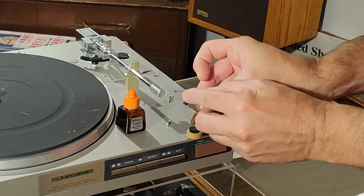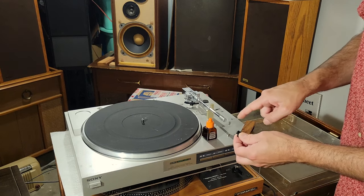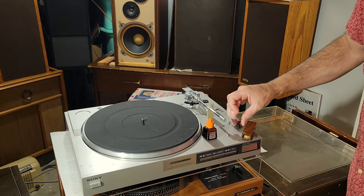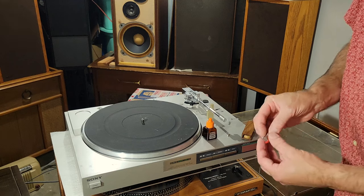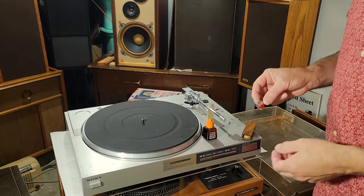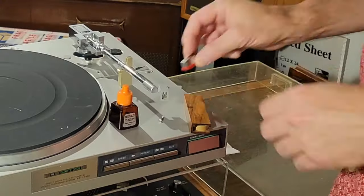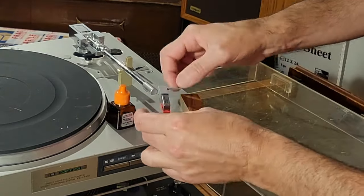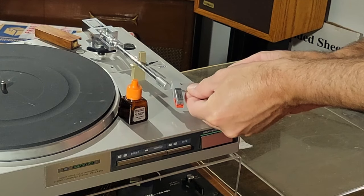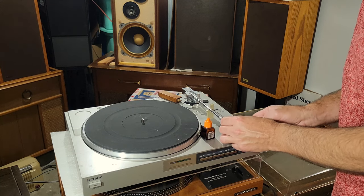These are relatively small, thin little prongs that go relatively deep into those sockets. I don't know if I will be able to get to an actual metal contact with my voltage probe. So the first thing I'm going to do, having cleaned off and verified that the stylus is reasonably clean and in good shape, is remount this and just verify that there is a problem. I'm going to hook this up to my amp and literally just give it a brush and see if I get sound out of my speakers. My student said he doesn't get any sound out of it, but I don't know anything about his ability to diagnose or use a stereo system, so I'm just going to check for myself.